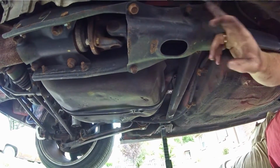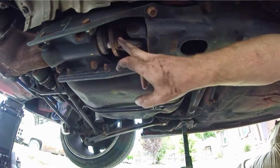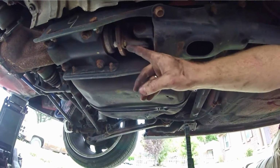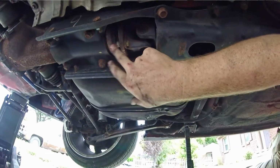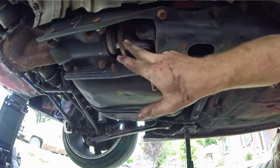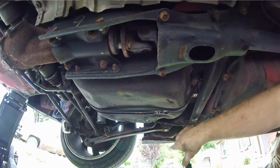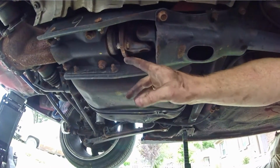So we're going to pull that down, and then even before we pull that down, we can start working on these bolts. So these are where we're going to take off of the rear diff. So I have the e-brake on right now, and we'll be able to break the nut loose. We're going to spray those with PB as well. But we can break the bolt loose, take it off. It'll slide out this way, obviously. And then you undo the e-brake and twist. Just roll one of the tires and it'll twist. And you do that to all four of them.